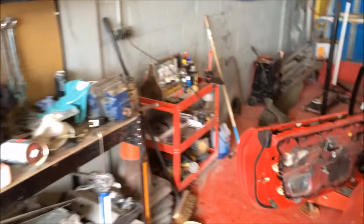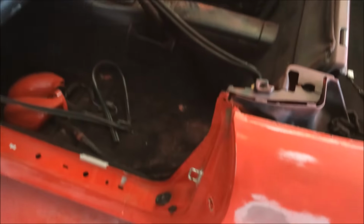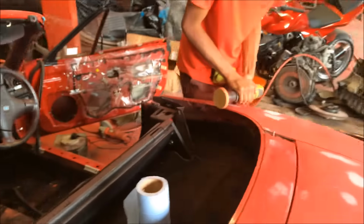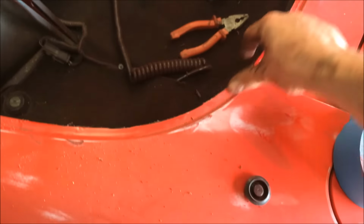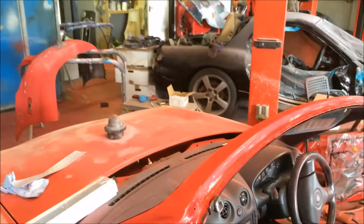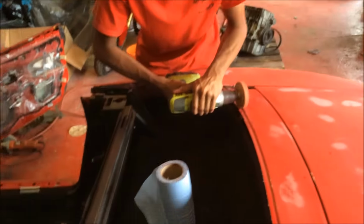And then we'll scuff into it with some proper 3M scuff blend and scuff finish, to create that seamless look, and you won't see where the paint's been at all. That's the beauty of all of this. So Kurt's just going around with the caramel wheel again and getting the glue off. Now, what we're going to do with this is soft edge it all the way around, mask off of that, no risk of bridging. Some more sand in there, and we'll be ready to blow all this off.